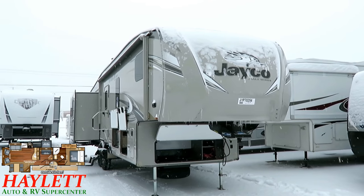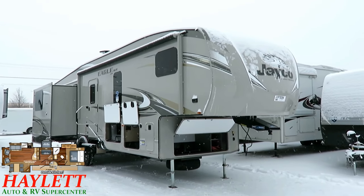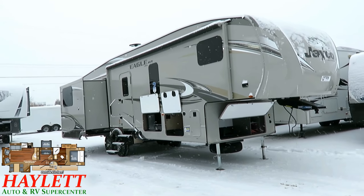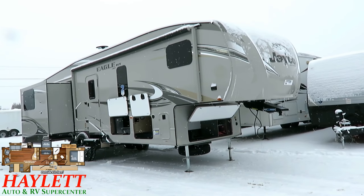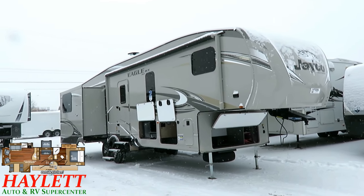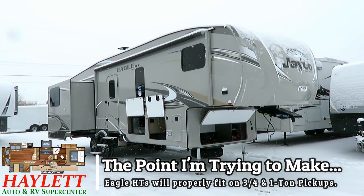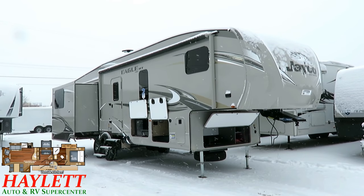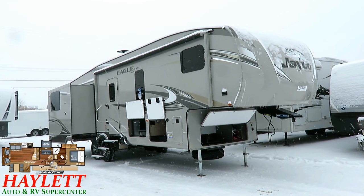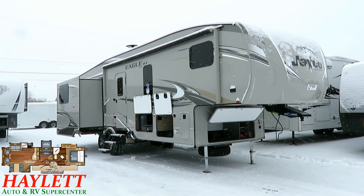Normally, I would tell you how this Eagle HT series, we like to outfit with larger 16-inch tires. One of the nice things about Eagle HTs is that they're not made just for half tons. Between the option for larger tires and the adjustable height suspension, an Eagle HT can actually be comfortably hooked up to a three-quarter or one-ton truck, unless you've done something really irregular — like a crazy 12-inch lift — in which case you shouldn't be towing a fifth wheel anyway. At 10,230, especially with the hitch weight on this, this is really above and beyond the reasonable boundaries for a half-ton series fifth wheel. You really need a three-quarter ton to tow this. I don't recommend half-ton towing this at all.